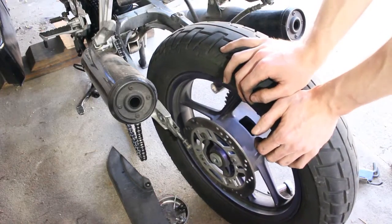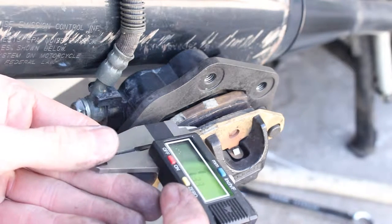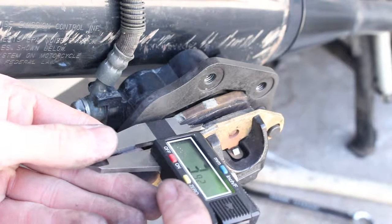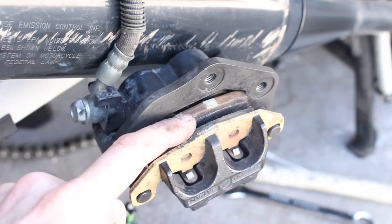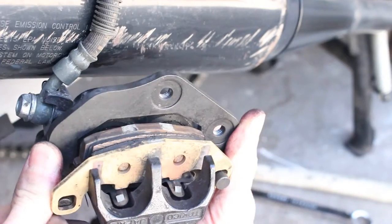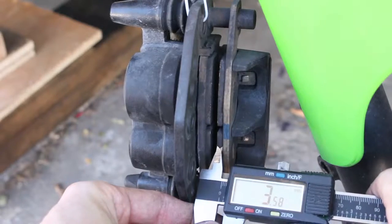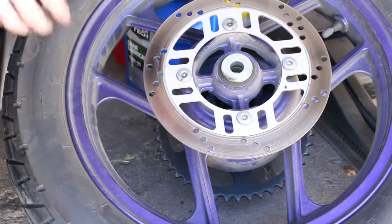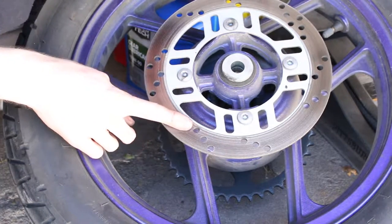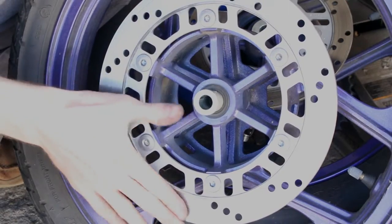At this point it's a good idea to bag and tag all the spacers, sprocket, and anything that removes from the wheels, so you can hand the wheels off to the bike shop without losing anything. Then take them to the tire shop with the new tires and reinstall everything in reverse. This is also a good time to check your brakes to see how much meat's left on the pads. Standard thickness per the manual is 4.3 millimeters — I'm getting about 3.74, which I'm fine with; minimum is 1 millimeter. The front pad measured at 3.58 millimeters. Looking over the rotors for any cracks — slotted and drilled rotors can develop cracks. No major warping. Front and back rotors look good, so we're good to go.